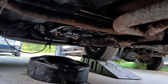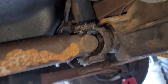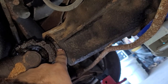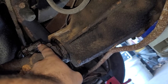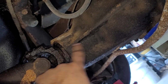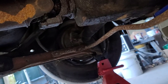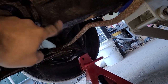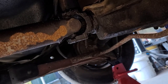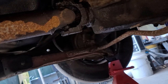I haven't checked the driveline yet, and this is what got me a little bit. The rear end looks like it's just soaking wet. But pretty much everything from this sleeve — which is part of the yoke — forward is wet, and nothing from the sleeve back. Why would this get soaked if the pinion seal was leaking? We'll check the fluid to make sure it's full, and we'll find leaks one way or the other.